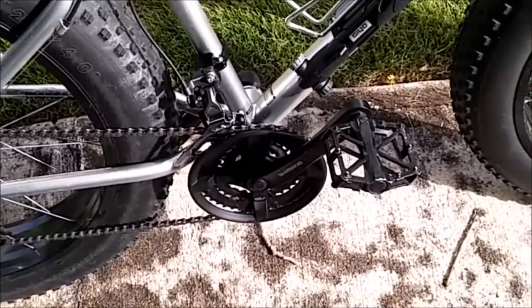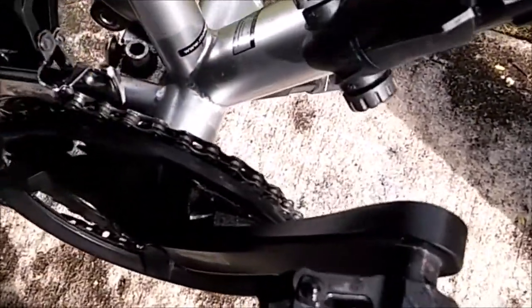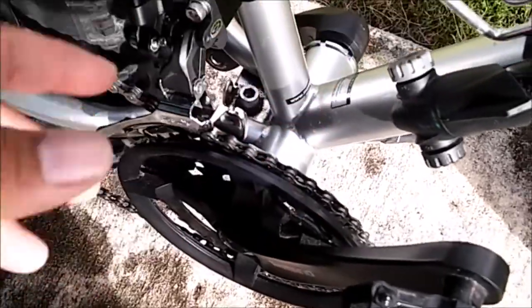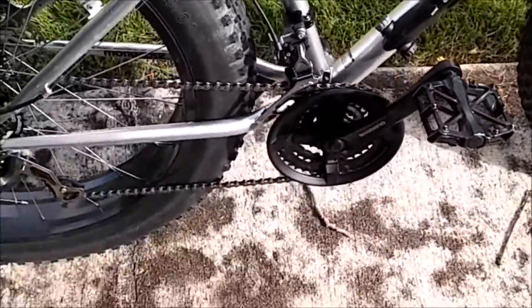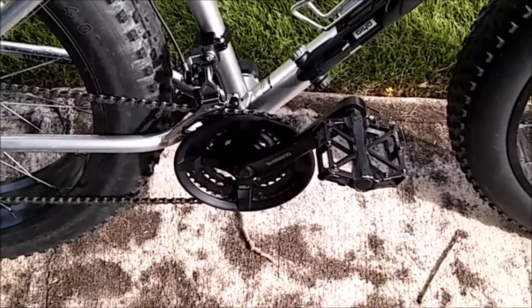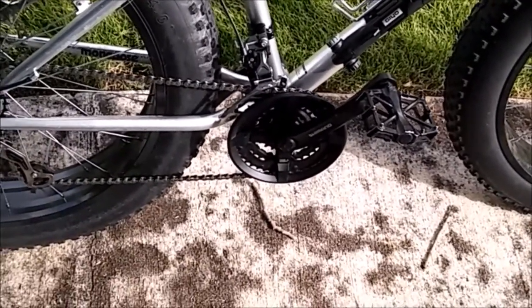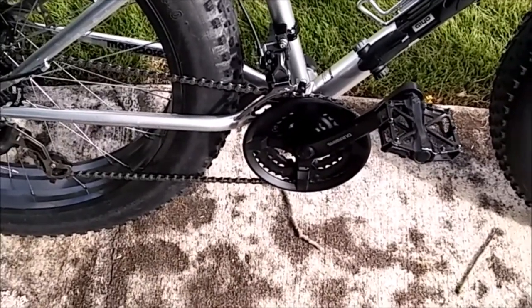Before I did this conversion I had an E-type derailleur installed and it was a disaster. I had two issues: one, this side didn't lock properly because mounting the derailleur on the bottom bracket cup moved everything out of alignment. The other issue was that the derailleur was lined up in a way that it didn't reach the last ring gear on my crankset. So that was a waste of time and money, and because of that I was forced to get rid of that approach and do everything the proper way — which is the direct mount derailleur with the direct mount clamp and spacer.